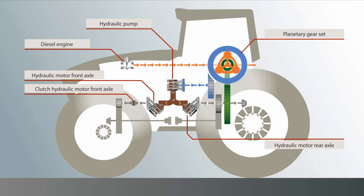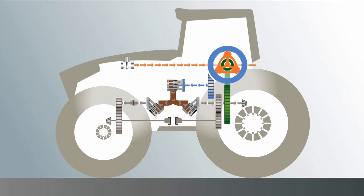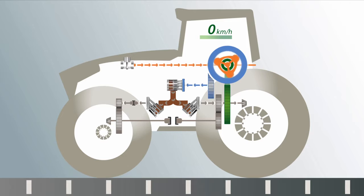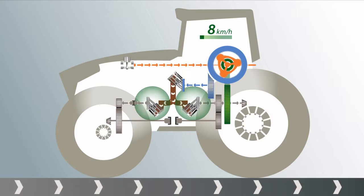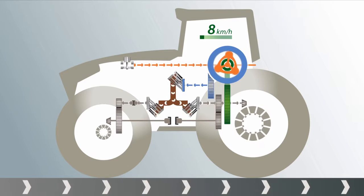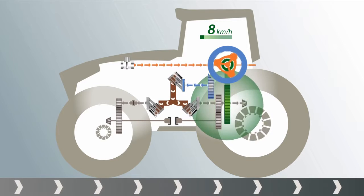But variable four-wheel drive means much more than that here. The clever part is the interplay between the front and rear axles. An intelligently controlled four-wheel clutch shifts the torques between the axles according to need. When we accelerate from stationary, the hydraulic pump swings out. Now both hydraulic motors receive drive energy and drive the front and rear axles independently of each other, while at the same time the rear axle is supplied mechanically.